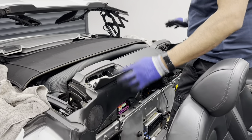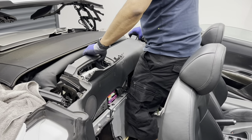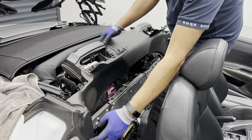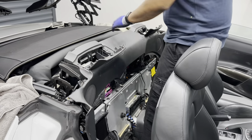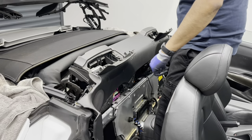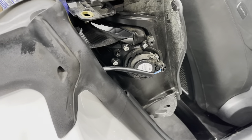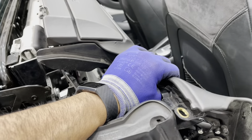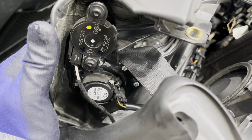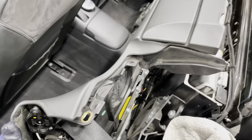This is now ready to come out. Remember when you pull it out, you've got wires over here and wires over here. To get it out, pull it up and lift it out, then feed it forward and seat it down. On the driver's side you've also got a tweeter that you need to unplug before lifting the panel up. On the passenger side you can see the tweeter and the parking sensor — you have to unplug these before lifting the panel.